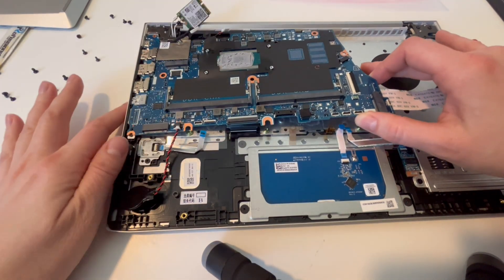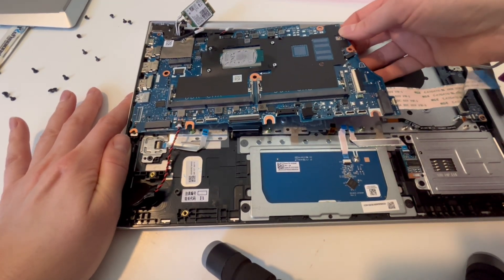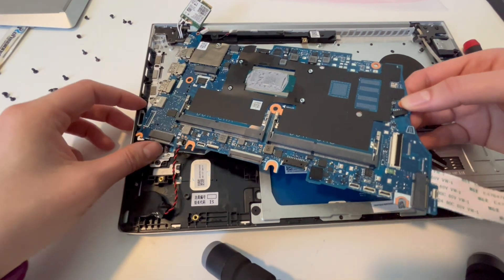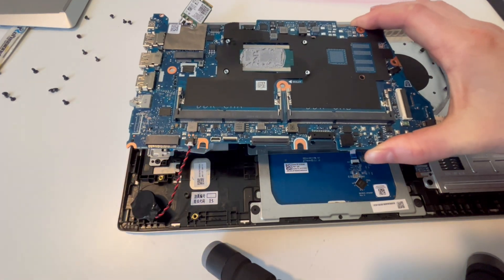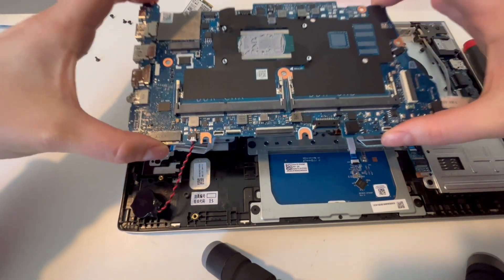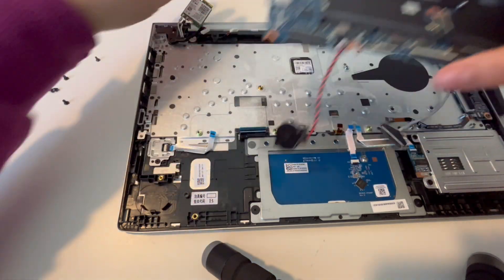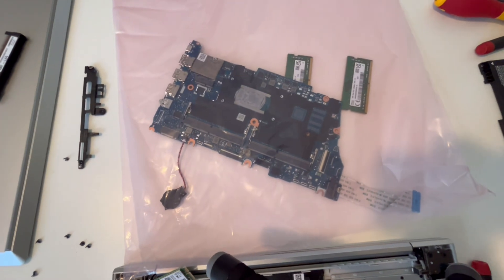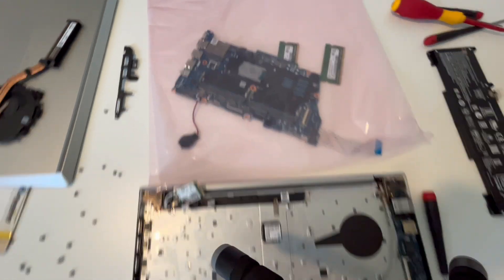Now my motherboard's free. As you can see, I tug and move it, but I resist the urge to bend it. Bending it is the death of a motherboard — if you want to brick your computer, then bend, yank, and pull too hard. If you don't want that, do the opposite. It came up. And as a follow-up: I did reassemble this and the computer works fine. I've done thousands of motherboards — I could do this in my sleep. If you have any questions, problems, or snags, leave them in the comments below and one of our technicians will get back to you. Like, share, and subscribe for more content. All my components are safe in their ESD bag, static free, and I am good to go.